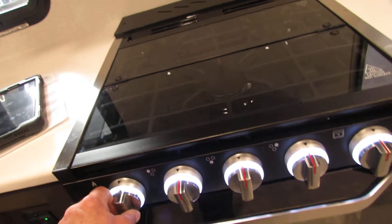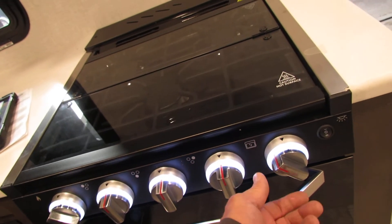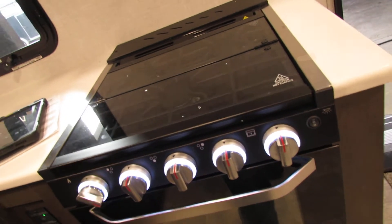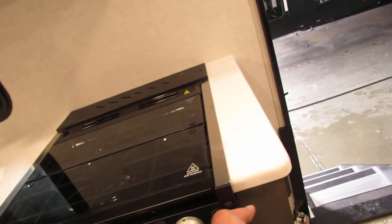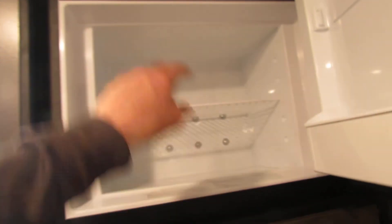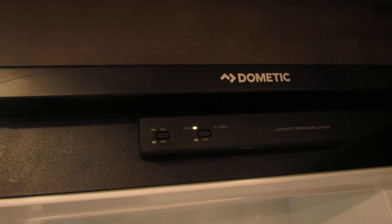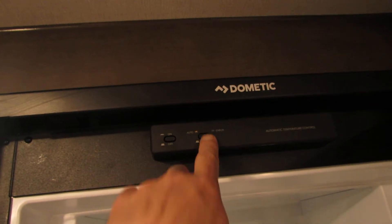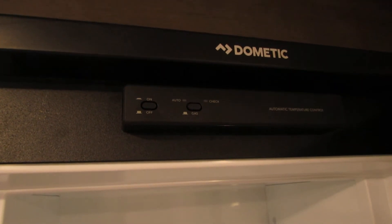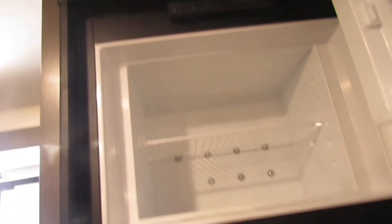You have an igniter for your stovetop. You'll have to hold the oven button in while you're igniting, and when it flames, hold it for a minute to get the thermocoupler hot, then use it as needed. It's got nice lights on it, knife holder in the back, and you got the light and fan, microwave. Refrigerator is gas and electric — when you kick it on, just turn it on auto and it'll automatically go to gas if you lose power. If you're in the woods or traveling, let the button out with no lights on. If there's a light on, it means it didn't ignite, so go turn your gas on and redo it — restart it right there.